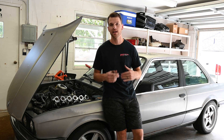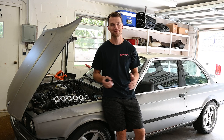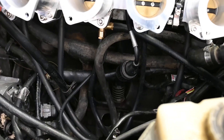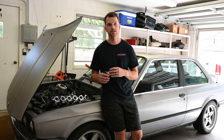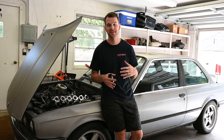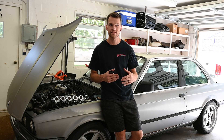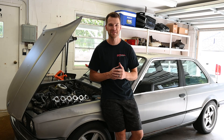I was really glad I came back to the house when I did, because upon further inspection I was noticing two oil leaks from two different areas, which was a little troubling because I really didn't do too much to the car. The first area was this evap tube from the crankcase up to the middle pair of throttle bodies. It normally goes up into the intake manifold, but for this one it's the middle pair of the throttle bodies. I noticed this leak because where the distribution block is, it just had a little bit of what looked like oil condensation. It wasn't a huge leak, but there was a little bit of moisture. It seems like the tube might not be inserting all the way up into the throttle bodies. I can just lightly tap the tube and it seems like it's pulling down, giving me a vacuum leak at that point, and any blowby this old engine might have would be coming out of the tube.